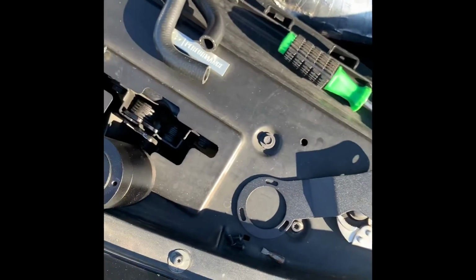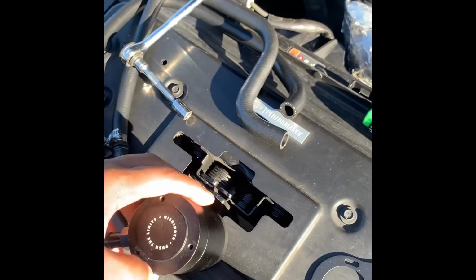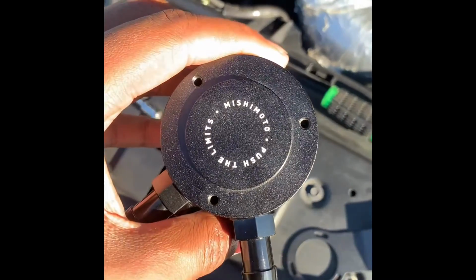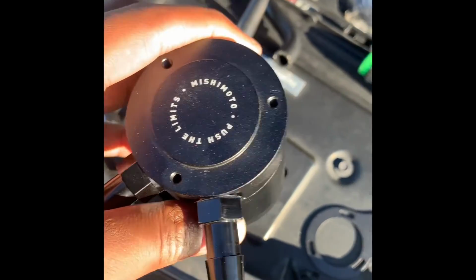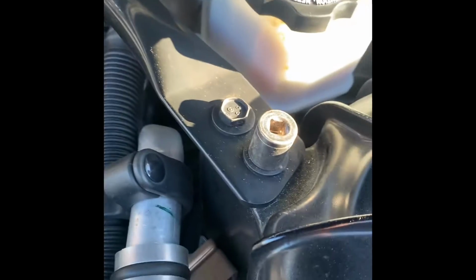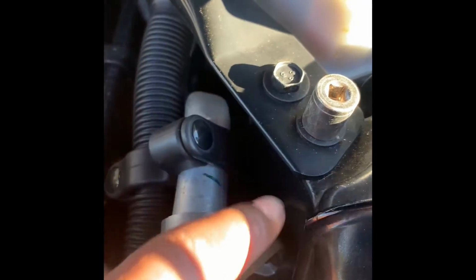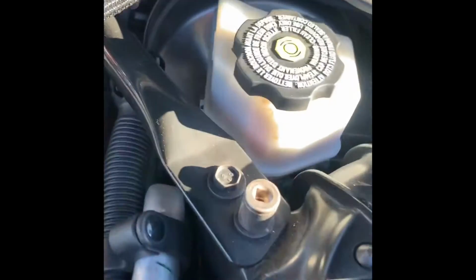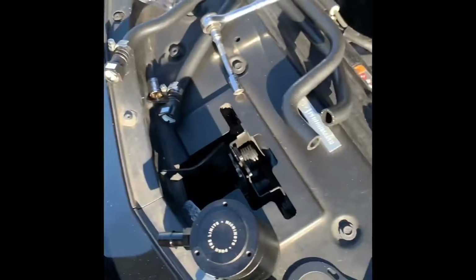If I had somebody recording, I'd be able to show you step by step, but this is the best I can do now. So just loosen those three little bolts at the top, put the bracket on, make sure everything's tight and snug, then loosen the bolts on the strut arm mount right here, slide these bolts off, attach this end of the mount right here, put these bolts on top of it and bolt it down, and then you have your catch can mounted.